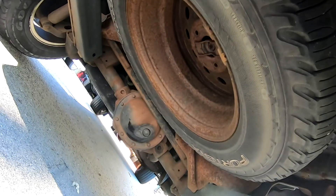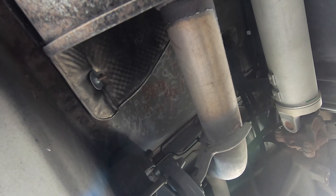The other complaint from the customer — aka the wife — was a clunky noise coming from the back when stopping and starting. I thought maybe it could be the spare tire, which is a full-size spare mounted underneath, but that was tight. What I did find was a little heat shield above the muffler that was hanging down and touching the muffler — so maybe that was the noise. I put a washer and nut to get the heat shield back up, but I'm still getting a little clunk from the back.